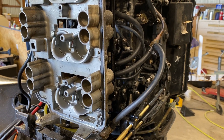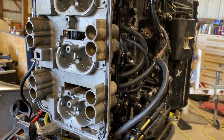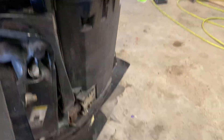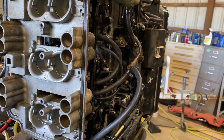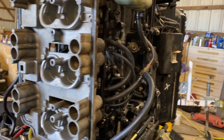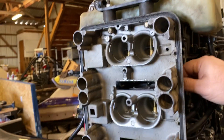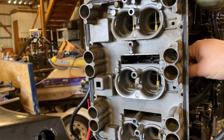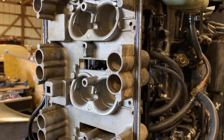You'd have to try to re-plane out. I thought okay, it's a spun prop hub or something like that — but that wasn't it. People said check your timing, check your link and sync, which is all the synchronization between the carburetors — in theory as the throttle moves they should all move in synchronization the same amount. But what I found was actually the problem was the throttle cable.